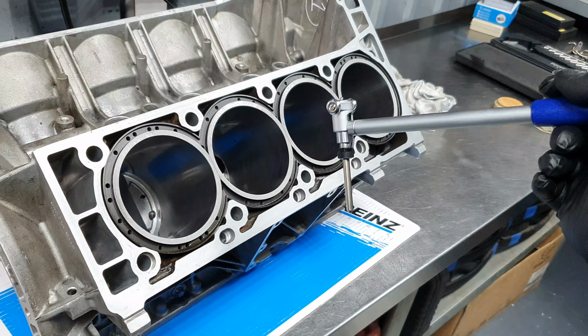The runout that the piston and the cylinder number 7 have, as an example, happened gradually over 280,000 kilometers, over 10 years, let's say. Nine years, all right, let's call it 10 to be round. Whatever runout the piston has is similar, and it happened together with the cylinder. So by opening it, cleaning it, and then getting the number 7 piston and putting it on number 1, and number 1 on number 6, for example, you're not going to have a happy end. It's going to be a half job. You're not going to be right.